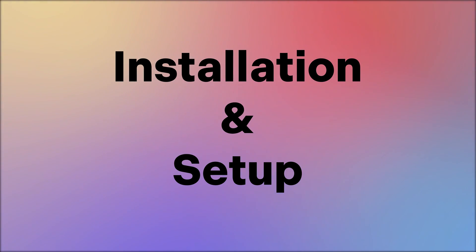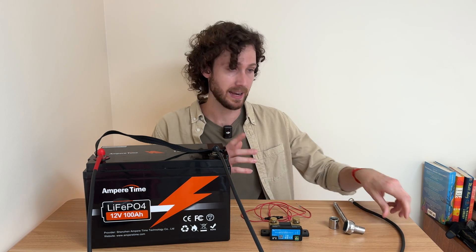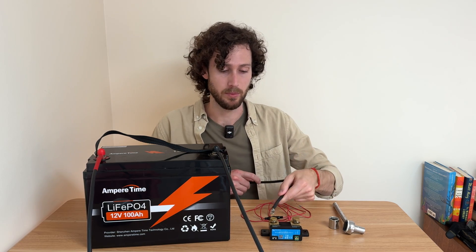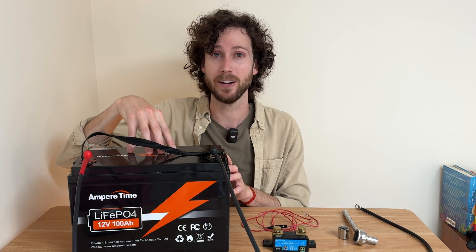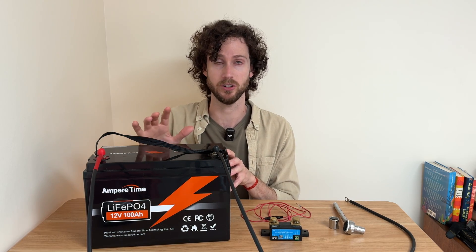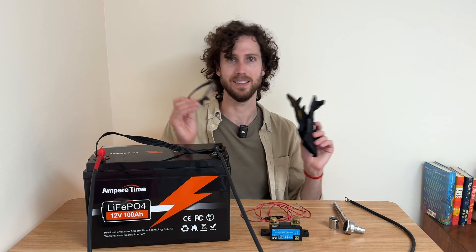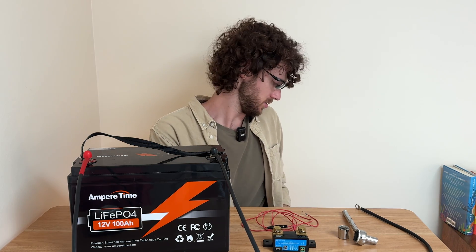You'll need a couple of things to install a battery monitor: a ratchet or something to tighten and loosen bolts, and a black battery cable whose ring connectors can fit on the bolts for your battery but also on the bolts for your battery monitor, which tend to be a bit bigger. The battery should be fully charged before you start — not just mostly charged, but 100% charged. You'll see why in a bit, so use some solar panels or your battery charger and charge it up. And it's always a good idea to use safety glasses and gloves.